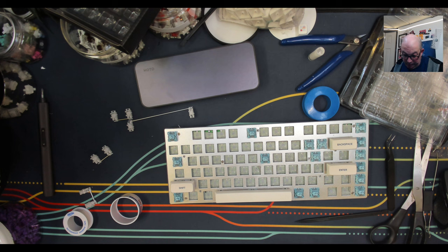So if you want to make sure that your stabilizers are rock solid, then I'd say buy some new ones and make sure they're lubricated. Most of them, like the SUMGSN I use, come lubricated. I've had to on a few of them just give it one or two wraps of the plumber's tape, but in most situations lubing them is more than enough. The tolerances are very good on those.